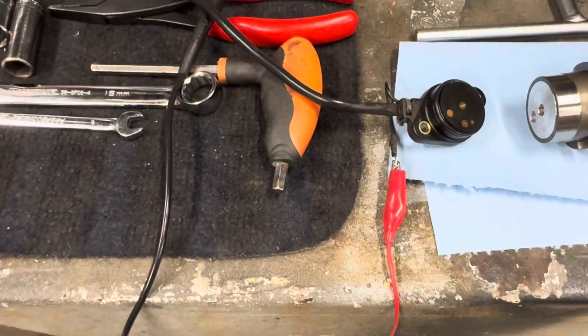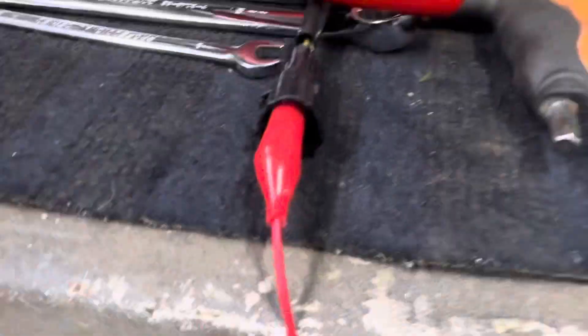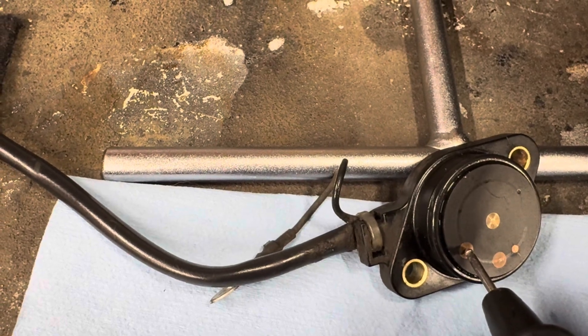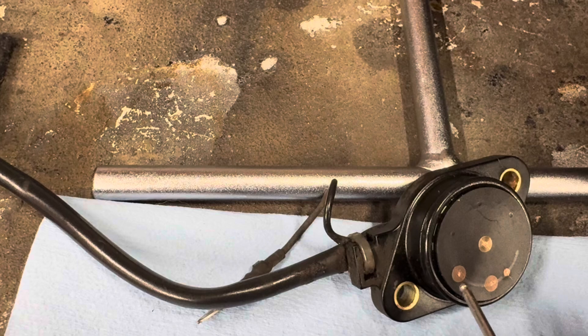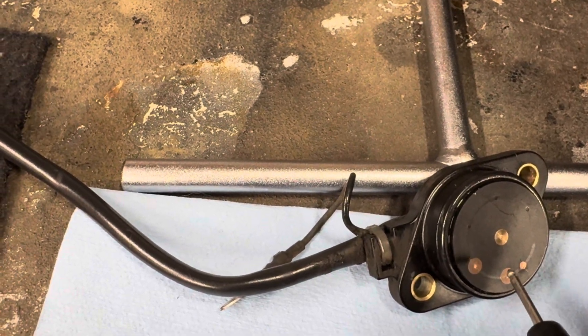If I change around — my probe wire is now connected to one of the three pins in here. And if I touch here, this thing beeps. So that would be third gear. If I change it, it would be over another pin in the connector — second gear.